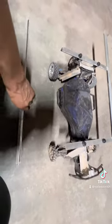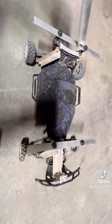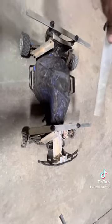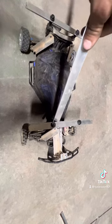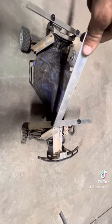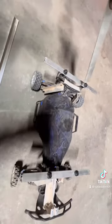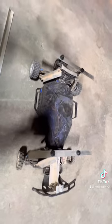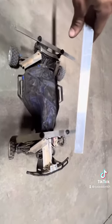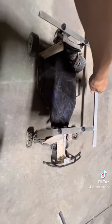So your side-to-side bars on a slash — these ones are going to be 11 inches wide. Then from the outside to inside is 3 and a quarter inches for your body mounts, on both front and rear. Our rules allow the roll cage to be within two inches of the front and two inches of the back.